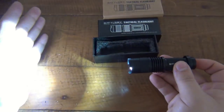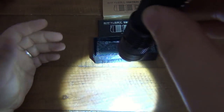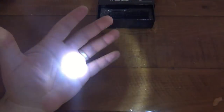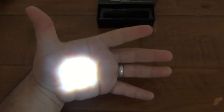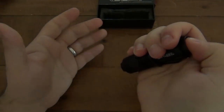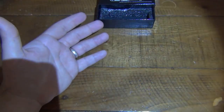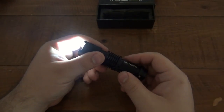Click it in for on — we have high here. If you do a half press, it changes the modes. There's low, and then there's strobe. But high and low are extremely close. On high, you can see the beam — it's all flat. It has a parabolic lens so it's adjustable; you can focus the beam. When you focus it down, you get horrible rings. Pull way back and rotate it around — you can see it's literally the shape of the LED. You don't get the detail in the picture because it's drowning it out, but on low mode you might be able to tell. It's just very, very low quality. It is a flashlight, but turning it on and off changes the mode each time, so it doesn't have mode memory — you have to make sure you're in the mode you want. I would never use this focused.